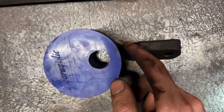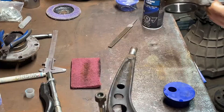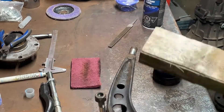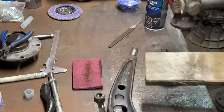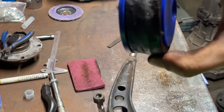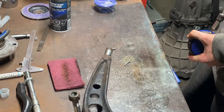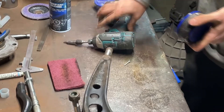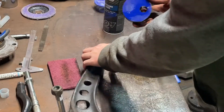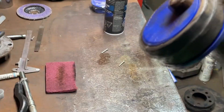Make sure the offset bushing is facing inside towards the tab — don't have it flipped the other way around. Again, you want it facing on the inside to how it mounts in the car. Give it a quick tap, and then find a small screw that fits in the hole. There we go — now there's no chance of this ever spinning, and it's ready to go back in the car.